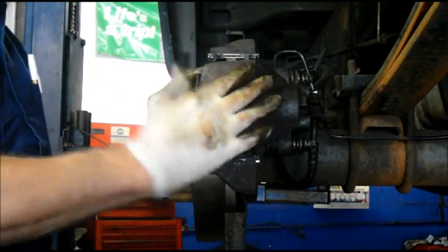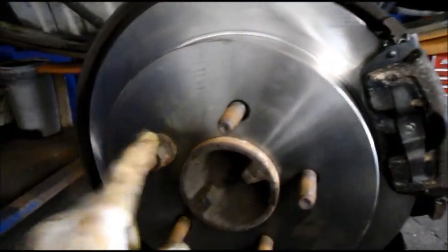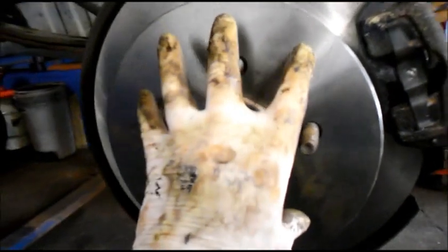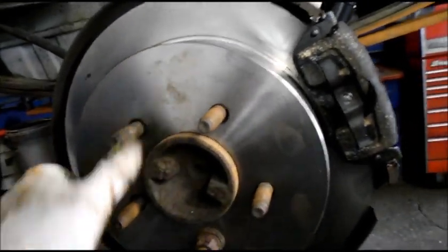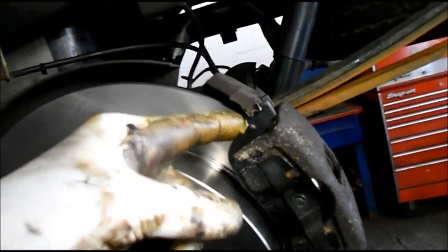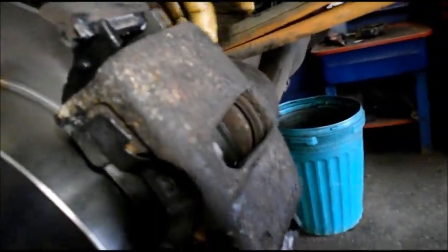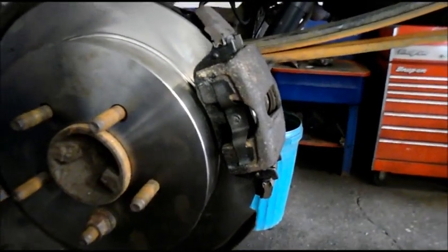Now we're going to go around and do the exact same thing on the other side. So we put our rotor on, put the nut on it to hold the rotor in place while we tightened up the adjustment. We did the parking brake adjustment under the bottom — adjusted it until it wouldn't turn any longer, then backed it off and just had a slight drag on it. We put our new brake pads into the caliper, made sure we had the groove cut out the way it was supposed to be on both sides. We installed our new hardware kit and lubricated the slide pins. We tightened up our 10mm bolts and that's it — we're all set. We're going to do the other side now, get the job wrapped up. As always, thanks for watching and I'll see you on the next one.